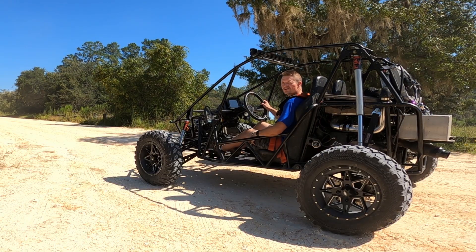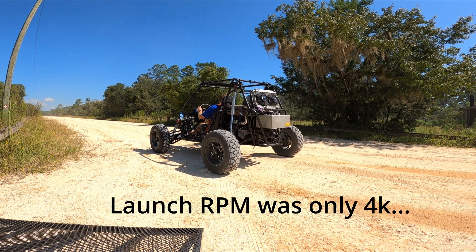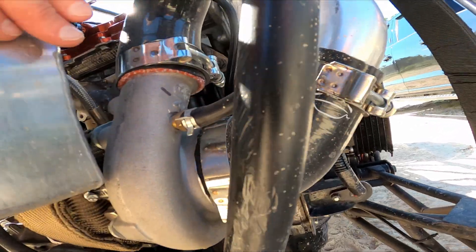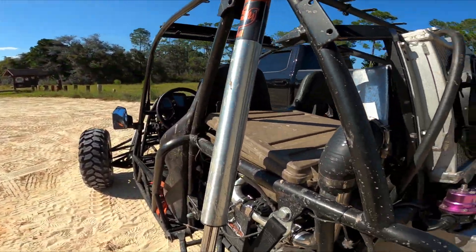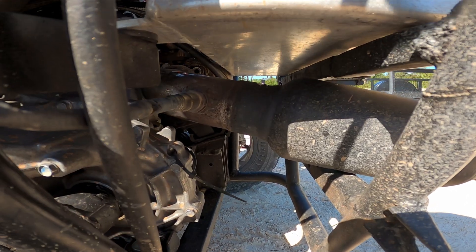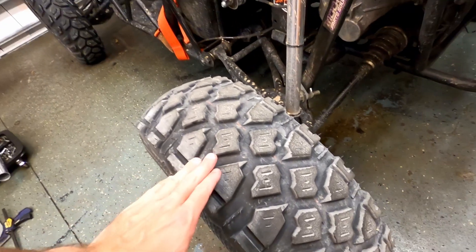Let's test launch control. That shouldn't be showing down there, so I think I did blow some of the charge piping loose. But it also just sounded funny regardless, and my AFR is really high. So I was looking under here and I noticed that, yeah, that's not normal.